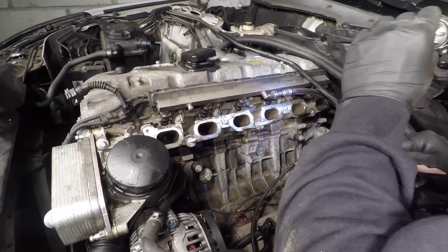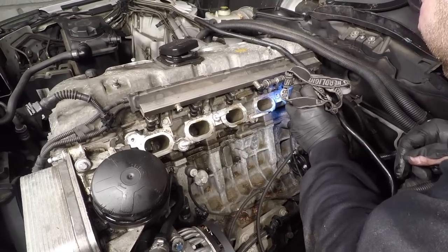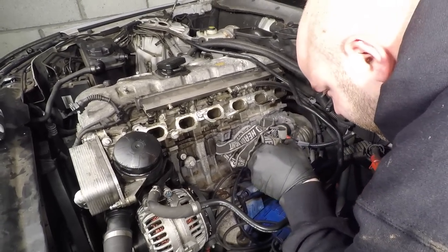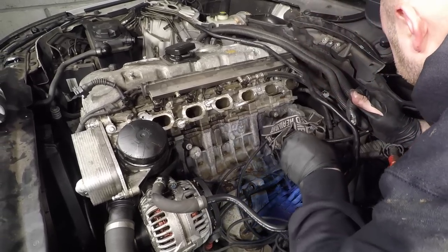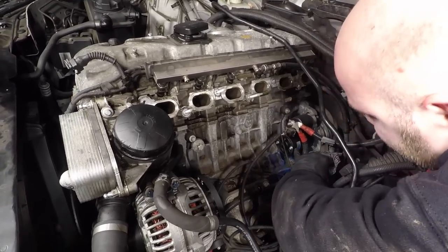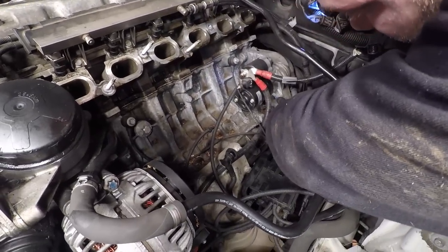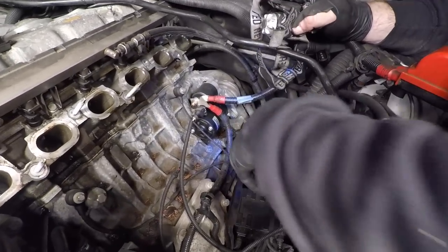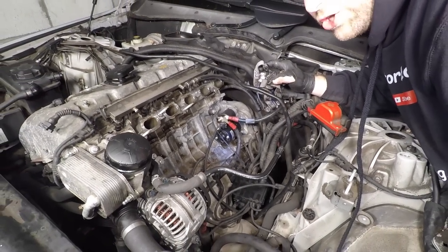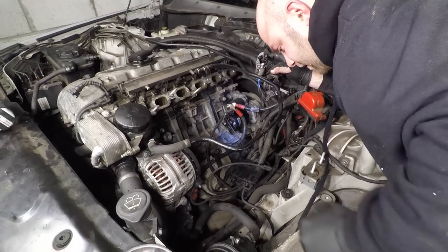That is the main cause of this problem — a blown PCV. It's a shame it wasn't replaced in time because it would have saved the valve cover. Looking at the valves with my torch, they actually look really clean — no carbon build up — so they may have been using injector cleaner. The starter motor has been replaced; it's an 'Auto Electrico' brand, not original BMW. You can also see new aluminium bolts — blue ones — going to the bell housing. Now we're going to replace the CCV. I'll show you how to do that on the bench, as we can't do it on the car.